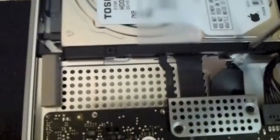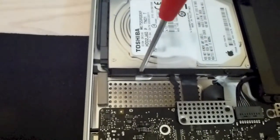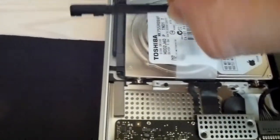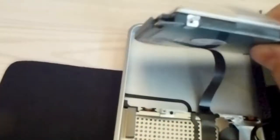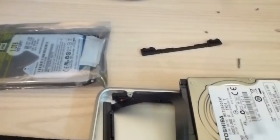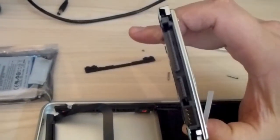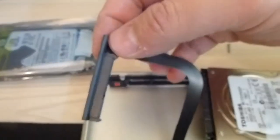If I put the original in and it starts working, then I know it's a hard drive issue and I'll just get another one. Pretty simple to do — you just unscrew these Phillips screws here, unscrew that one, and this should just pop out. I'll leave the screws in there still, and then you've got this flap here that lifts out nice and easy. Nothing crazy — then that unplugs from there and you put the new one in.